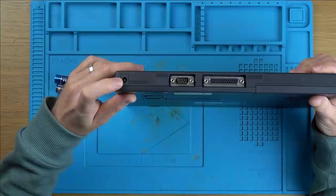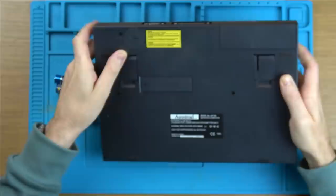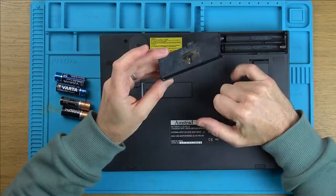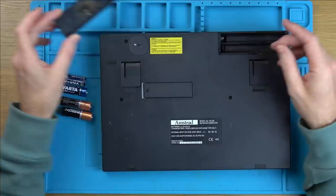I've had a look at the back and it takes a DC jack. Six volts but the centre pin is actually negative. I hope the last people didn't put the positive in the middle because normally it's positive in the middle. I haven't put the batteries in yet but it looks wet. When I put my little finger in there and wiped it, it's still wet. I've got a really bad sense of smell because I either have hay fever or a cold, but to me it smells a bit vinegary. Yet the compartment is clean here. I'm just going to get a towel and wipe that up.